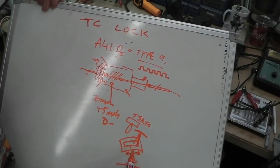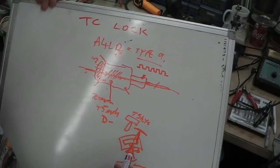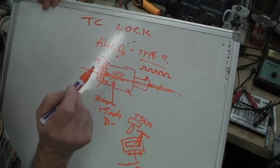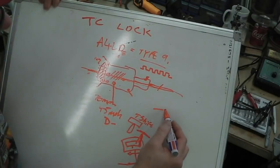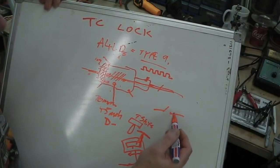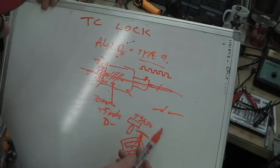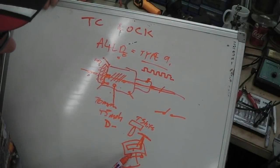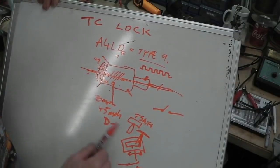That's part of the element of this design we're about to do. So it's not going to come on unless you're in D. I don't want it coming on when my foot's on the brake either. So we've got a brake pedal switch as well as an element here. So brakes on, torque converter lockup will drop out. Any position other than D, it won't be active.